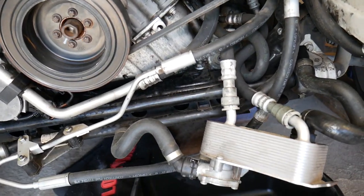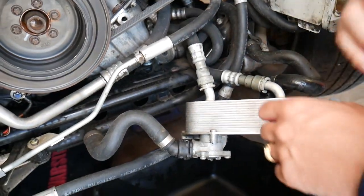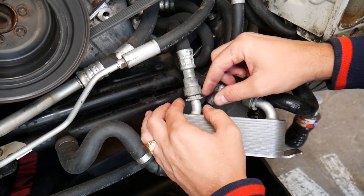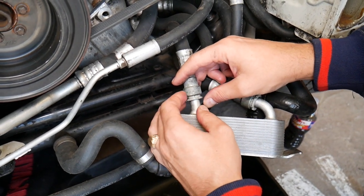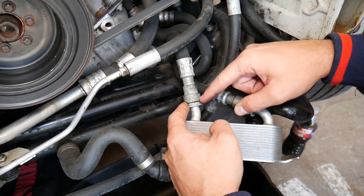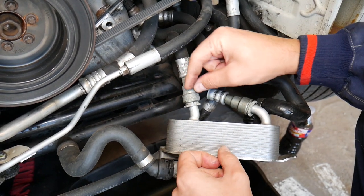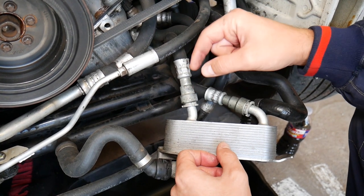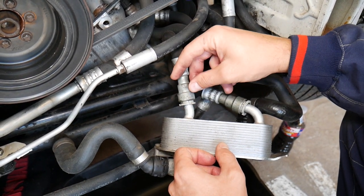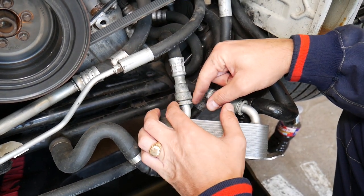This is the line, this is the hose. You have that special tool — a fitting — that BMW installed, and you're going to use that fitting to actually remove the hose. Most people don't know about it or don't do it the correct way, and they'll break it or pull it out and it will break. Later they'll install the hose without that fitting, and at that point it's bad because you don't have the fitting to remove the hose.